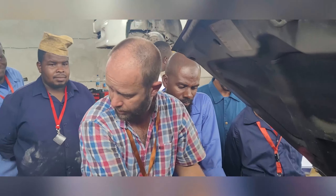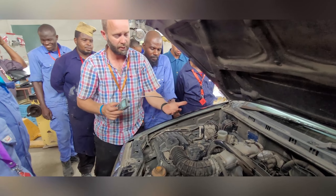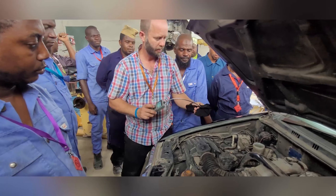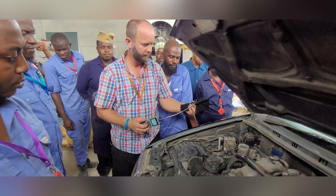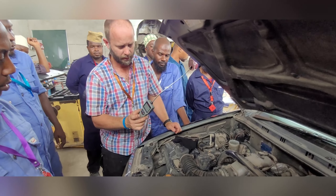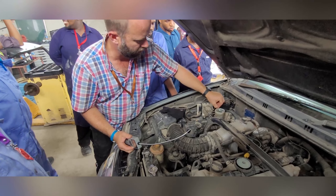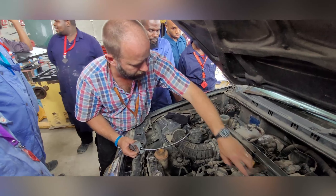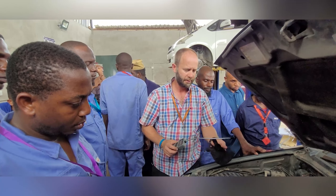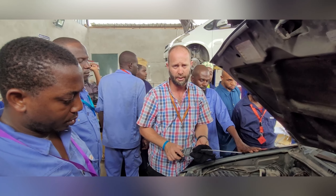Careful — any drip of this on any paint will take off the paint. Have it cleaned nicely, switch it off, and you already know the state of the brake fluid. Put it back on, put the filter on, put the cover back, and you can talk to the customer and tell him the brake fluid should be changed, otherwise you will have further damage inside your system.